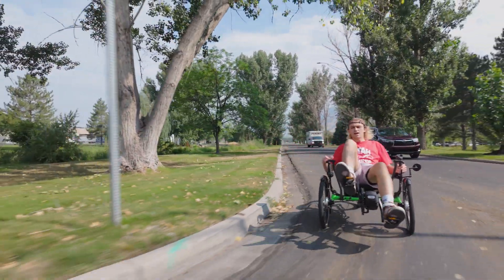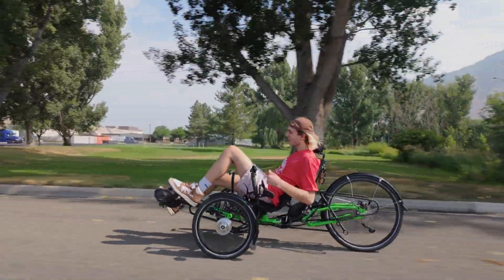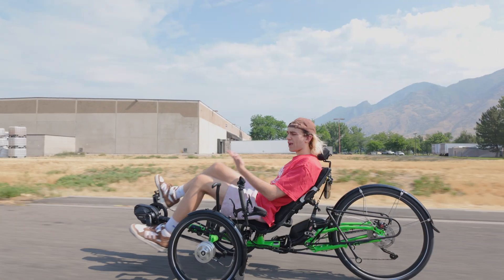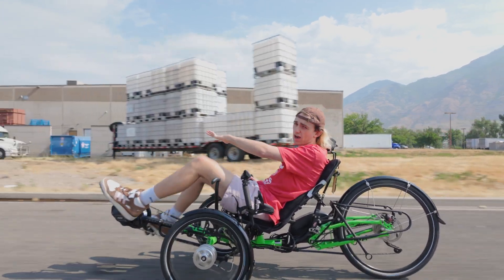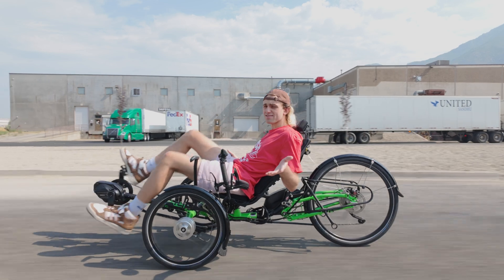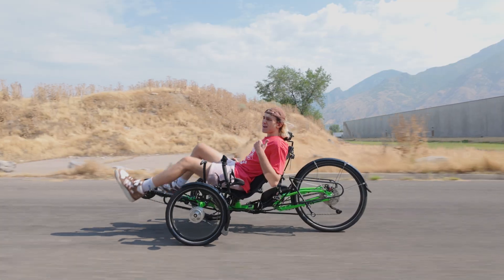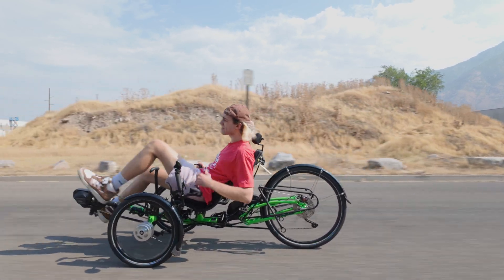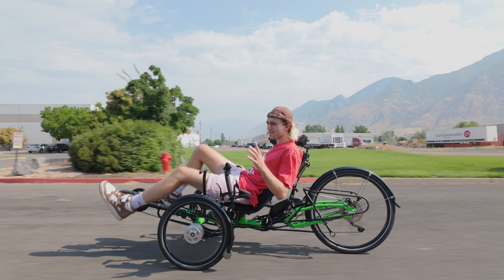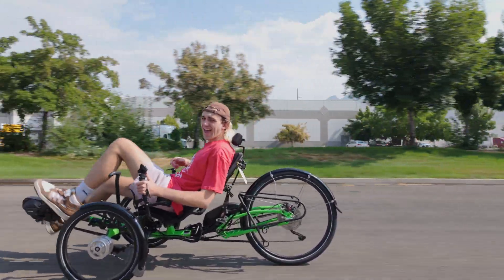One thing to talk about is going uphill. The cadence sensing motor and the torque sensor have a big difference when tackling bigger hills. With the cadence motor, it's still really good for hills — it makes it feel like you're riding up flat ground. It has so much wattage that it can really push you forward, which is a nice assist for some people. But sometimes you want to feel those harder hills a bit while still having assist. In my many uphill rides with the Bosch motors and these torque sensors, you can really still feel the hills — it still gives you that challenge, but it's always there to support you. You can always pump up the next assist mode and go even faster.